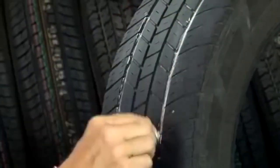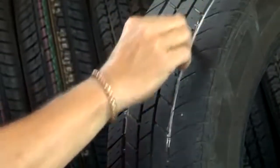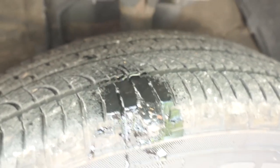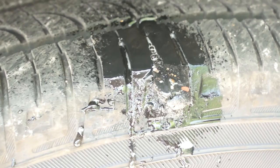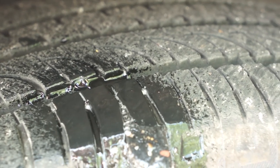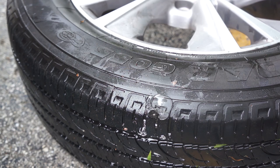The first thing you want to note is whether or not a tire is repairable for safety reasons. It is not recommended to repair the tire outside of the repairable zone. I plugged this tire in an unrepairable area because I got a flat when I needed to get somewhere quickly. Plugging a tire is a temporary fix — I plugged this tire two weeks ago and it's now leaking. Remember, this is an unrepairable area.